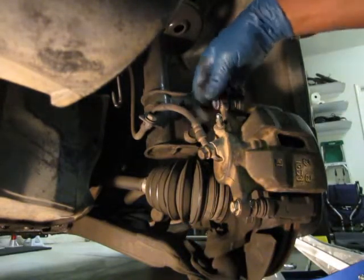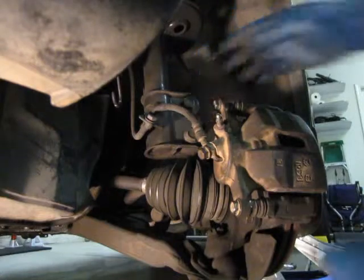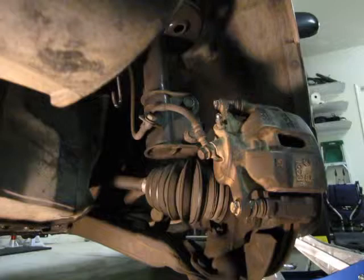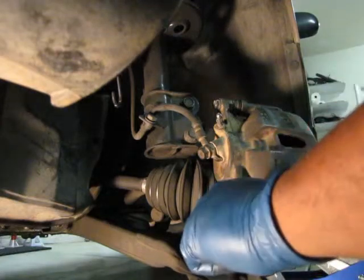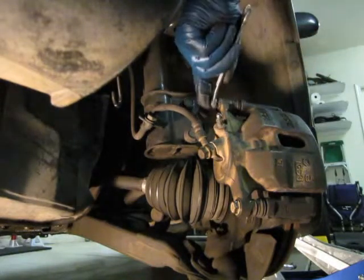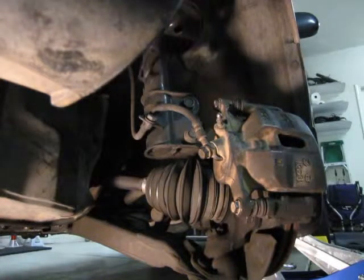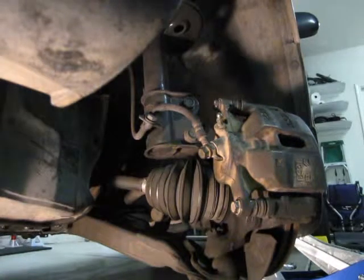And then you get your box-end wrench or your ratchet. Some people may want to use a torque wrench and torque it to manufacturer specification. That's always advisable and recommended. You just get your wrench, turn in a clockwise manner, and I just get them good and snug. I don't torque them. Good and snug, but not too tight. And that's generally good enough. Don't forget your bungee cord. And I just changed the brakes. Now you do the other side.